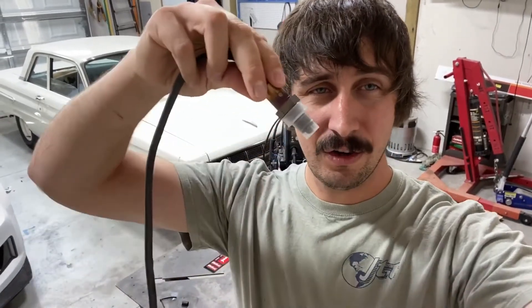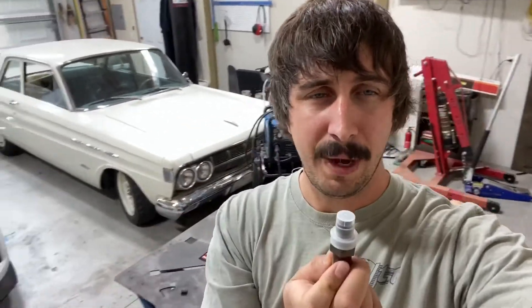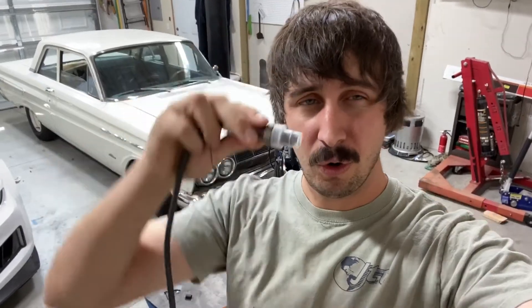The other thing is: when you start up your car and see some condensation coming out of the tailpipe when it's cold, that will mess with the sensor. They say you want to install this 10 degrees above horizontal. If you've got a little bit of condensation coming through the exhaust, you don't want the sensor on the bottom where that's collecting — that'll mess up your sensor, shorten its life, and give you bad readings. So just make sure when you drill your hole that you angle it up a little bit and you'll be totally fine.